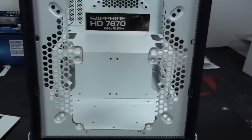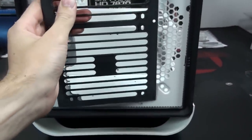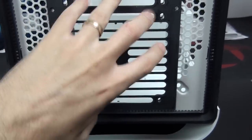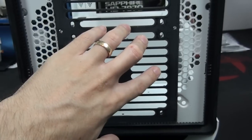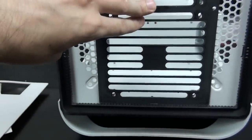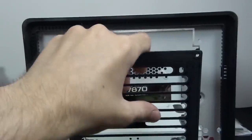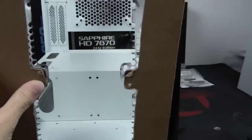The reason I did this was to improve airflow and aesthetics, because I'm planning on using a radiator grill — this is a Phobia 240mm radiator grill. There's no point in having two panels; it's only going to look terrible and restrict airflow. So I cut everything out from behind that and left behind the radiator mounting holes to increase the strength of the configuration.